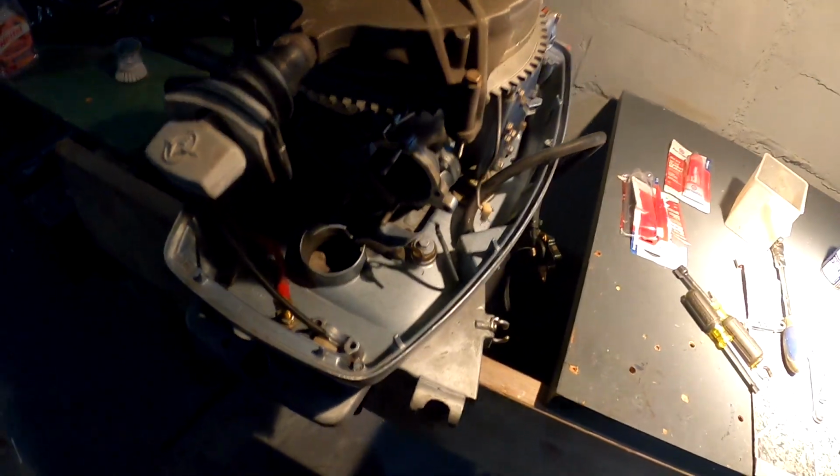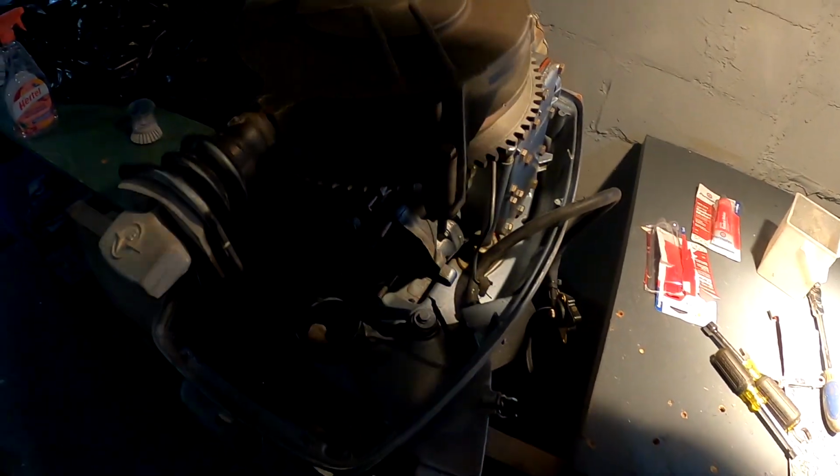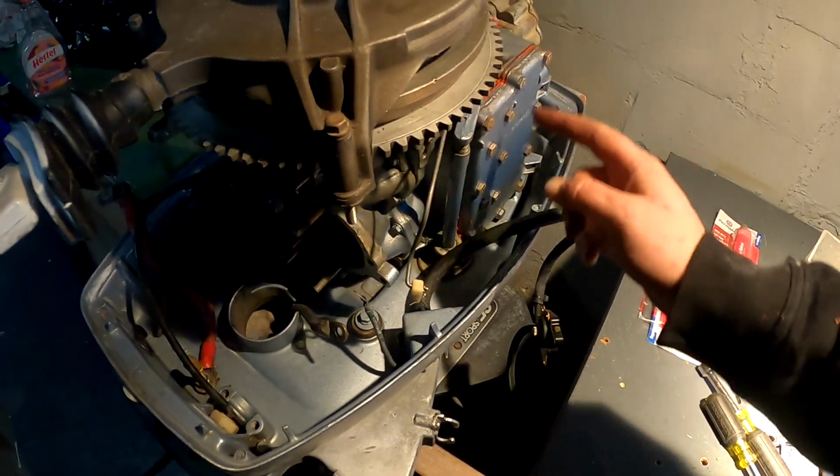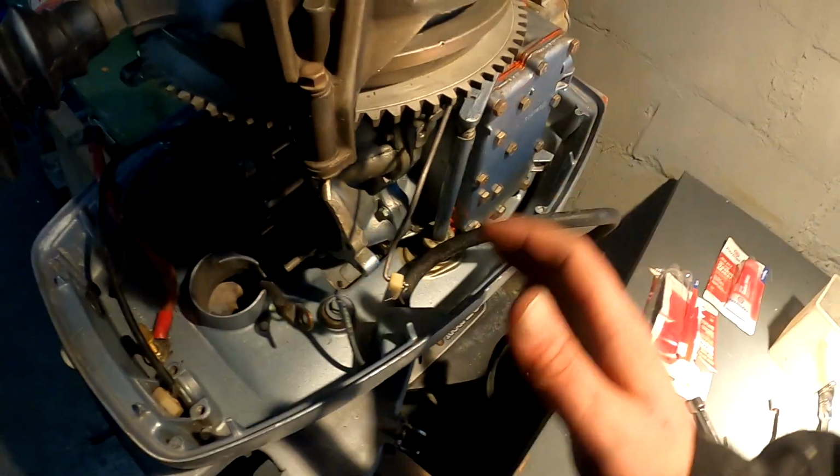As you know, we did the gaskets on the top end. We're really hoping that they seal properly, no leaks, and then obviously that we didn't mess anything up compression wise. But now that I put those plugs back in, even though they're only hand tight, they should create some sort of seal. And if everything else goes good, I'll hear the air as I turn this now. Ready? We have compression. Now, obviously, I put the gauge on it after to check my compression and everything, but we have compression. So, not a complete loss. Hopefully, it's not messed up, but on the right track.